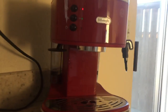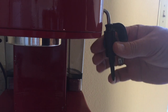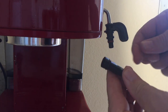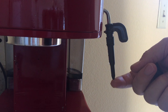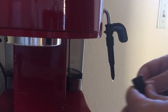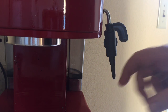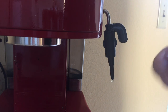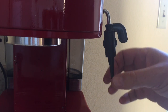I want to talk in detail about what I did to the milk steamer, because some of these basic machines come with this piece here — it's actually the locking piece. I'll take it off so you can see straight through it. It locks the wand in place. Now, with these cappuccino makers they supply a big sleeve that comes down over the top with an induction hole, so it's always drawing air in. I found it was quite uncontrollable as far as how much froth it was making — it was big bubbles and froth, not proper crema.